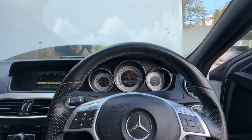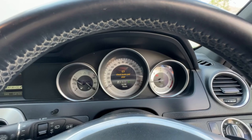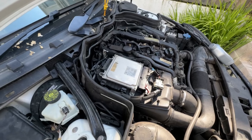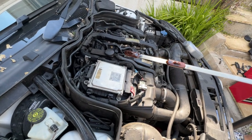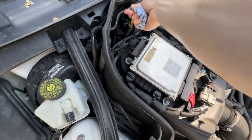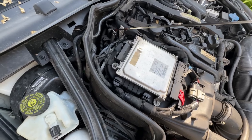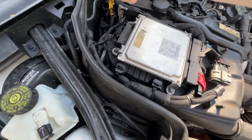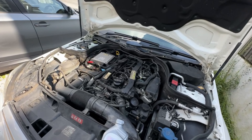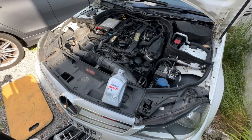The sound is even better now. Need to change the brake pad wear sensor because we broke it. We just checked the dipstick and it's pretty much at the top — full now. We put six liters in. It probably had a little bit left in that didn't completely drain out — we say six and a half but it probably only had about 400ml left in it. We're happy with that. That's it all serviced now — just need to put the cover back over the top. Thanks for watching guys, hope you enjoyed, and we'll see you in the next one.